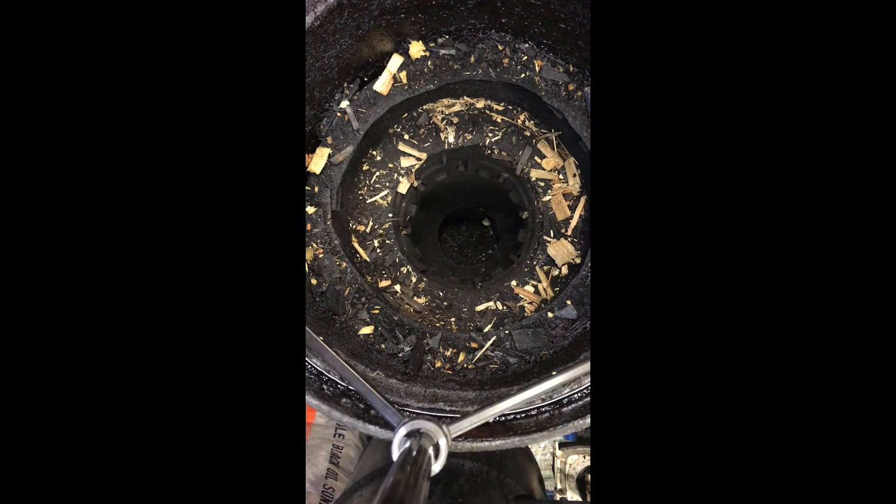If you use this method, turn your blowers on and that'll suck down all of the excess dust and prevent you from getting carbon boogers — that's what I call them. It's not really a defined cone, but anything that's fallen through doesn't need to be there, so it's sitting down on the grate. I'll go ahead and shake the grate real quick and start loading in the charcoal up to the nozzles — my very basic shaker. Found a couple holes. There's a little wood chunk down there but that'll be fine. Now we're ready for some charcoal.